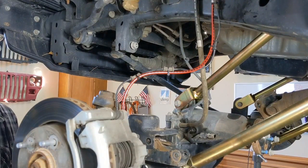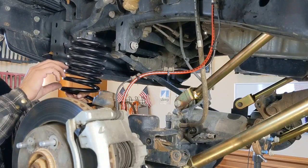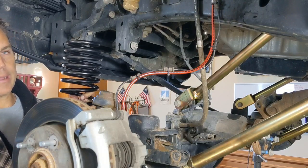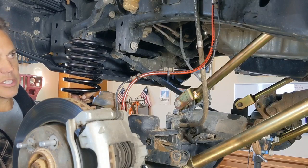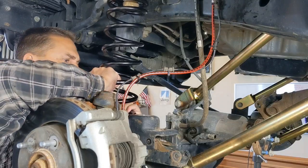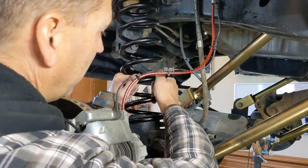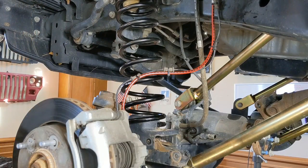It's time to put springs in. When you do a lift, it can be tough to get the springs in, especially dual rate or progressive rate springs with tightly wound coils — you can't get a spring compressor on there. What I always do is droop my axle as much as needed to get the springs in, then when you jack it back up it compresses the springs. Also make sure you get the pigtail of your spring on the index here, so it's lined up and the spring won't rotate more than when you're on the trail.